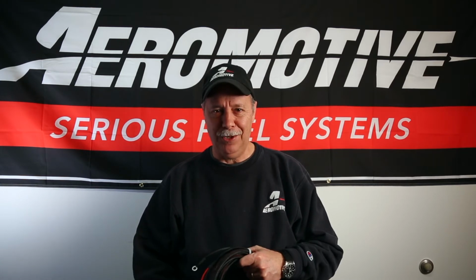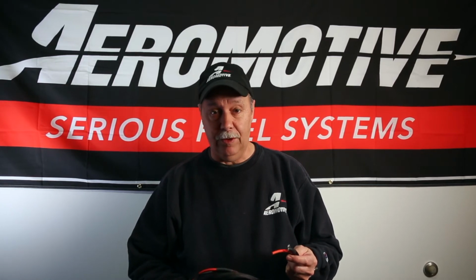Aeromotive offers a wiring kit, part number 16307. And 16307, it's really a great piece. It's made the way a wiring harness should be made. That is to say, it's made with 10 gauge power and ground wire. It's got over 18 feet of wiring length. Actually, there's an 18-foot run from the relay to the fuel pump, and there's another 4-foot run from the relay to the battery.